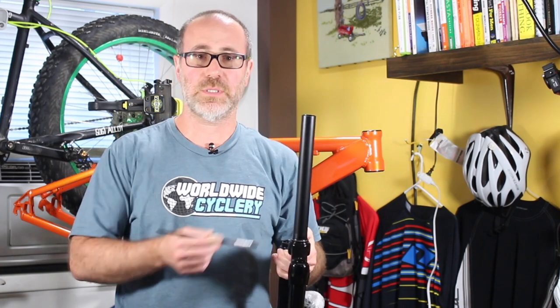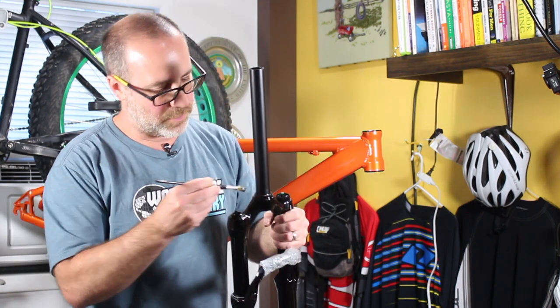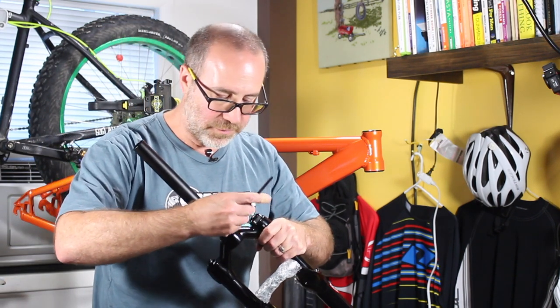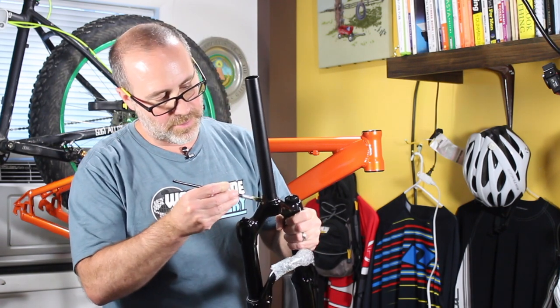In order to make sure we do it right, it wouldn't hurt to put the bearings in and everything, so let's kind of pre-fit it and get an idea of how we're going to do here. I'm going to drop some grease on the bottom part of the fork and put the bearing in. I'm pretty liberal with the grease on this part of the bike because it's just going to wear and fall within the bearings as well. I'm going to put some more actually on the bearings itself.